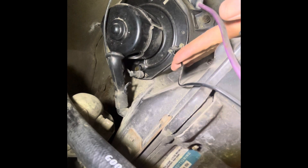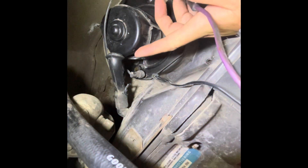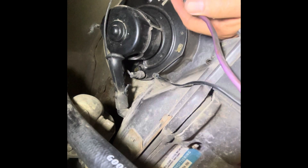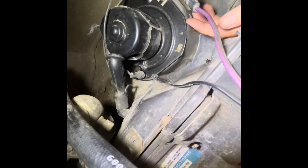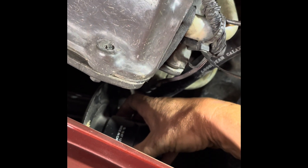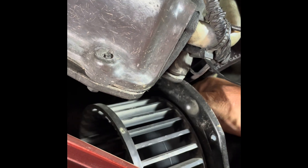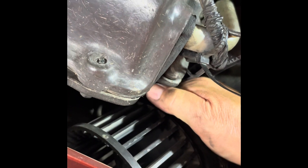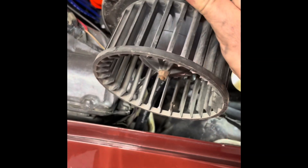With the reservoir out of the way, you can get a better idea of how the motor looks. You can see a ground plug — single pole — that I've pulled off, and there's also a power connector down towards the bottom. There's a single pole tube which is a fresh air line that hooks straight into the motor case as a press fitting. There's also an arrestor, which just keeps the noise down on your radio made by the blower fan. It's held by five quarter-inch bolts. Take the most difficult to reach screws out first. When you get the motor out, you can just flip it around, spin it, and out it comes.